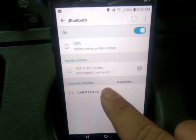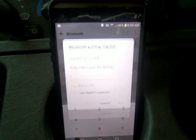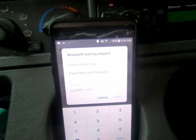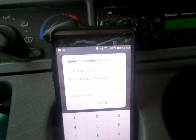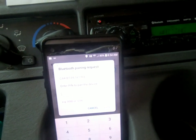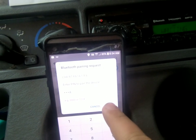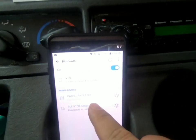Okay, let's hit Search again. You can see down here the car radio is showing up, so let's tap on that. It found it. Now what it wants is our password. If you don't know your password and you've never done it before, the factory setting is either 0000 or 1234. Mine was all zeros — I changed it to 1234 — so I'm just going to type that in: 1-2-3-4, and hit Pair. You can see our radio here is still waiting, doing its thing.